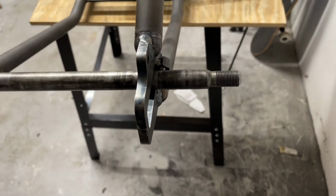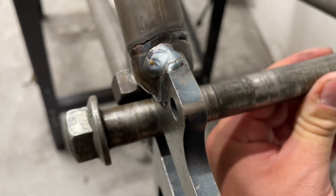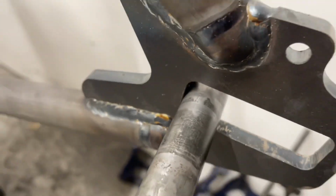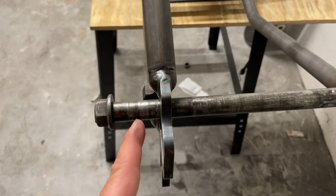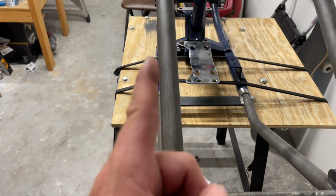So once your axle is in the kit, you can see now, once that's flush, how much more we're working with. So what you want to do is come out past the adjusters, just enough to where that's all the way bottomed out, and this side's all the way bottomed out. But still having enough distance right here to get a reading off of your tape measure.